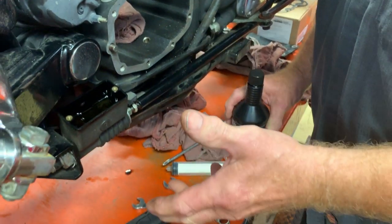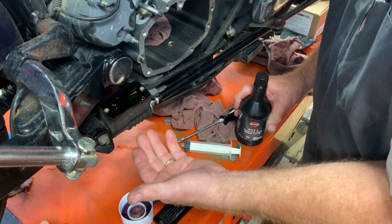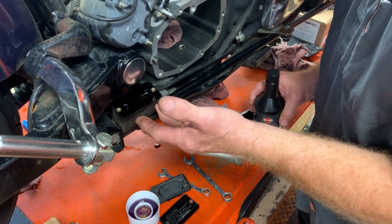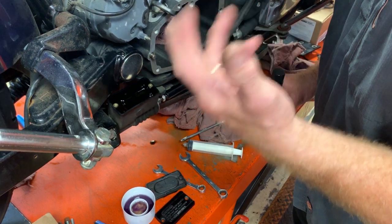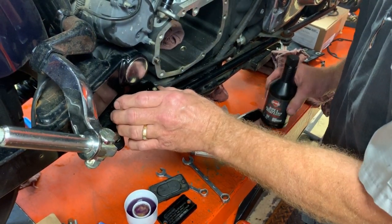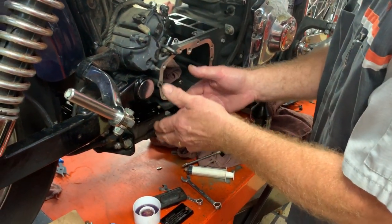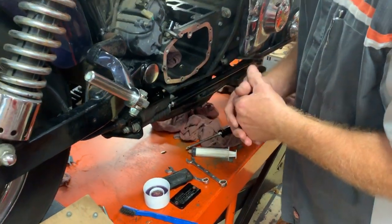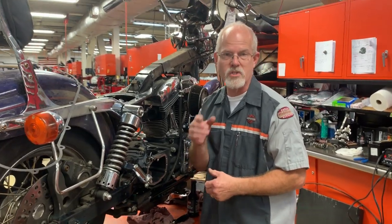DOT 4 — it's not as easy to tell the difference, but with DOT 5 you can take a sample out, put it in a little white cup, and if it's brown, change it. The factory always recommends every two years or very high mileage to change this. And if you live in an area that has a lot of moisture, change it more often. This area is the most neglected thing on a Dyna because of its location, but it is one of the most important things you need to keep on top of. Just a little tech tip from Lowcountry Harley-Davidson and Doc Harley — we'll see you next week.